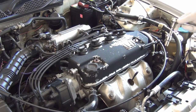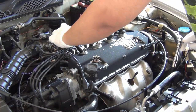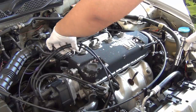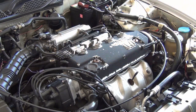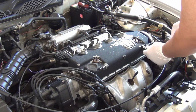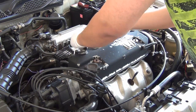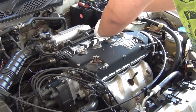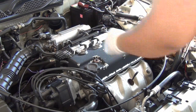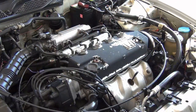The engine cover is held by four nuts. Now those two nuts in front here, just screw them off. The other two nuts are way in the back, so you need to remove those ignition cables in order to access the back. There's two here. Of course you need to remove the accessory screws that are holding the cables, the ignition cables, and so on.